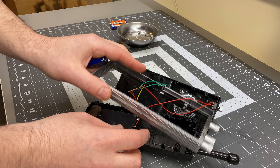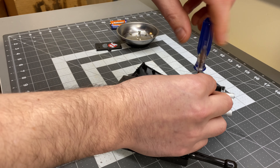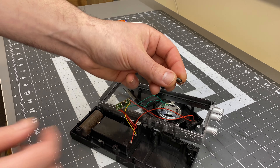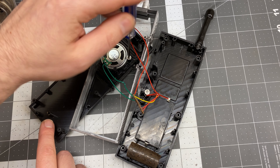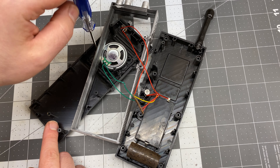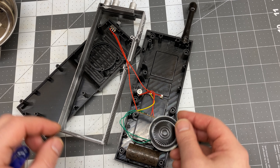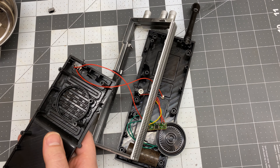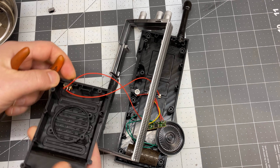There's a few pan head screws with washers attached to them that we'll need to remove first. Some of these are going to attach to the activation slide, and there's a little spring, so make sure not to lose that. Once the screws attaching the switch are removed, we can take out the screws attaching the speaker to the front of the radio — there's two of those pan head screws. Then we can nudge out the speaker, making sure not to bend the wires. Pop off that top on-off switch, and with a little cajoling, we can take out the switch itself and put that on the other side too.